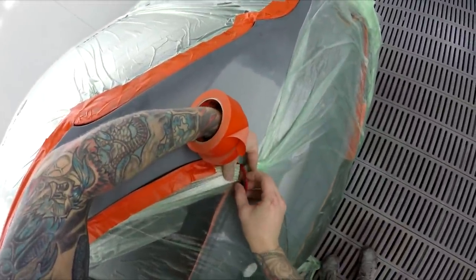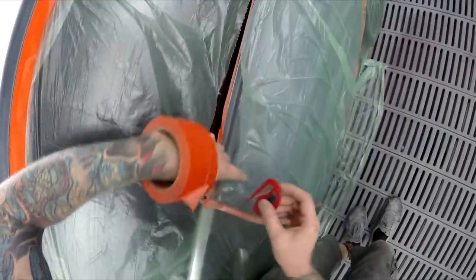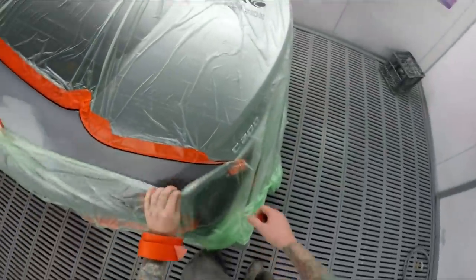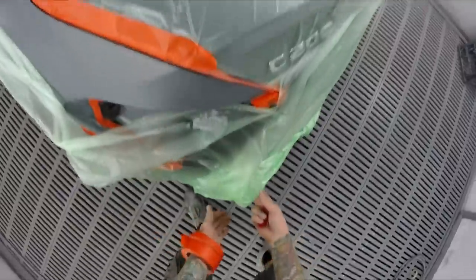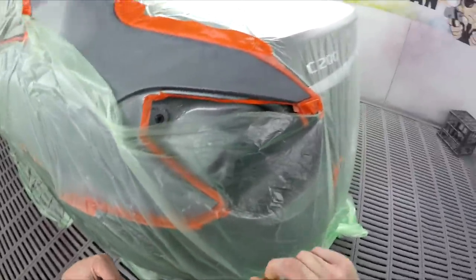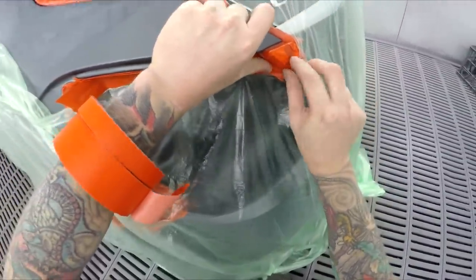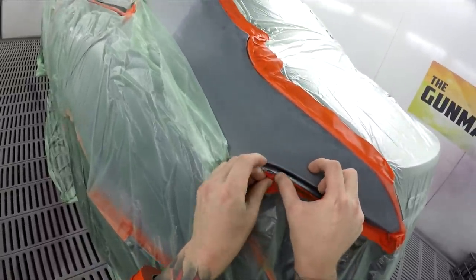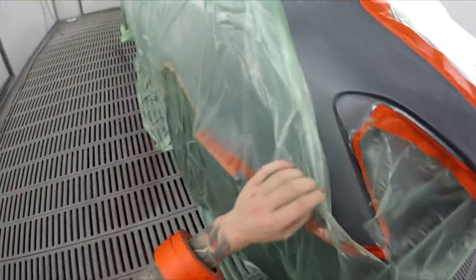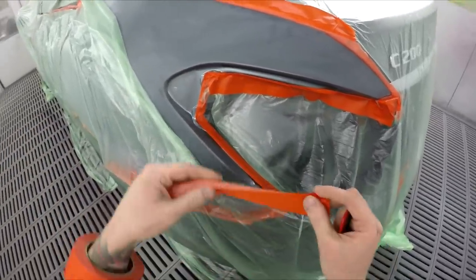He's the one that taught me a very popular trick I showed you guys in another video - where if you're putting two-pack fine filler in, you can put a little bit of base coat color in it. I sprayed my bonnet red and only had blue hardener, so I just put a bit of base coat red in there. That's what it's like in this trade - you pick up tricks off everyone and add them to your bag.